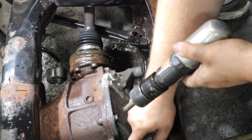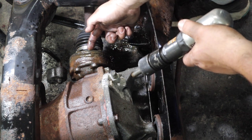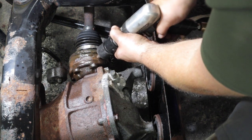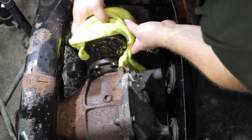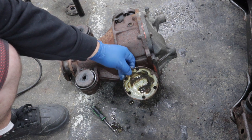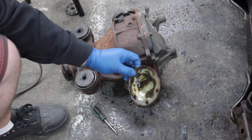This axle has been so stuck - both of them. I cannot get them off of the output shaft of the differential. This part of the axle is completely seized in here. The cap of the axle where all the grease and the CV joint is has come off. I'm using an air chisel to hammer around this ring to loosen it up. The end cap for the axle was stuck inside the output shaft on each side, so I pried it out with some picks. I'll clean this up, put some more grease back in the axle, and reassemble - the axle shouldn't be bad at this point.